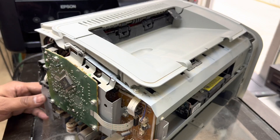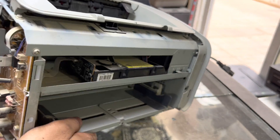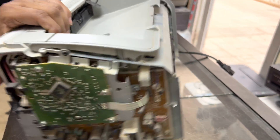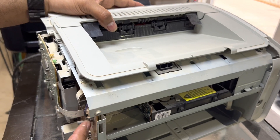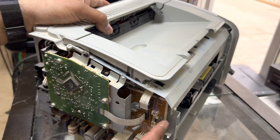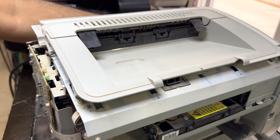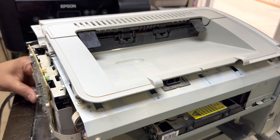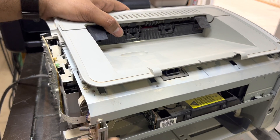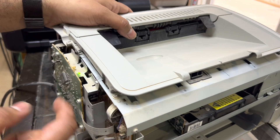As I told you, there can be two problems: one is the high voltage board over here, something inside. This is the high voltage board, but first of all we will check our button — maybe this button has a problem. Sometimes with heavy dust or carbon buildup inside, the button will stop working. I will connect the power cord again and press this button forcefully to check. Look, I pressed it forcefully and it's working.